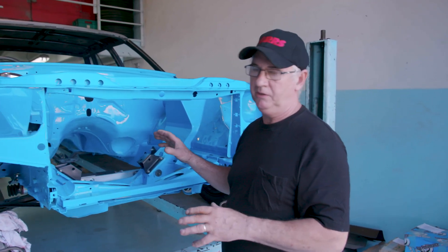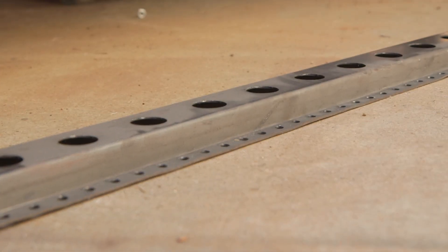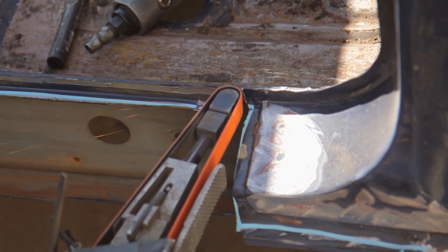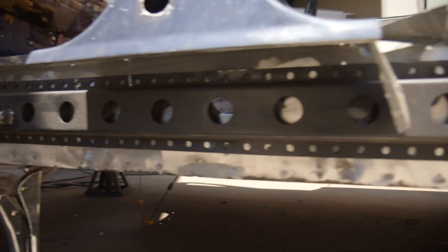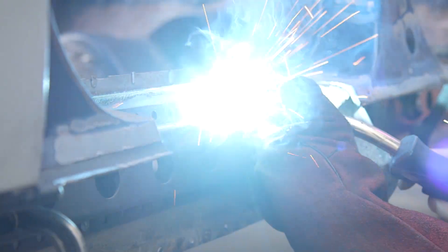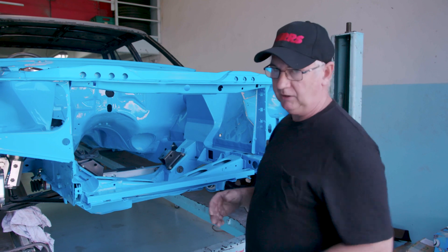In the very beginning, one of the things we had to deal with was the immense amount of chassis flex in the vehicle. It's got our sill reinforcements — we removed the outer sill casing and welded in a full length chassis stiffener. We've also had to notch the shock towers to get clearance for the big FPV motor.